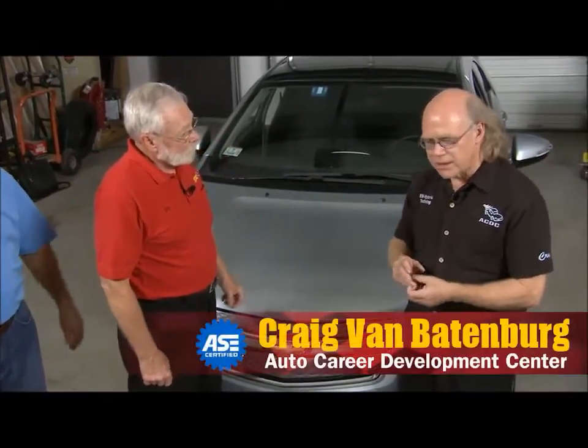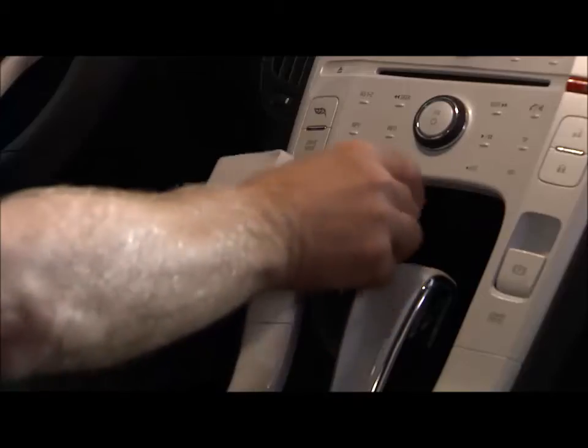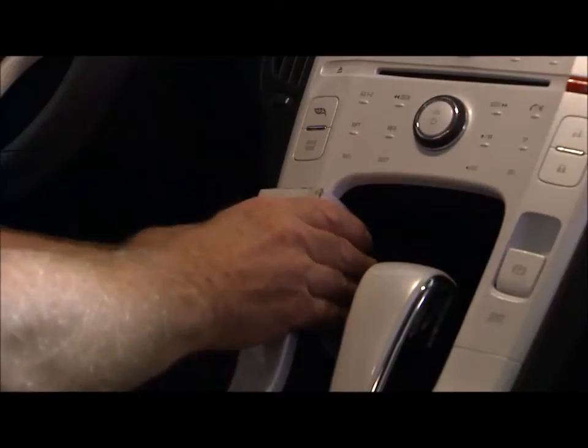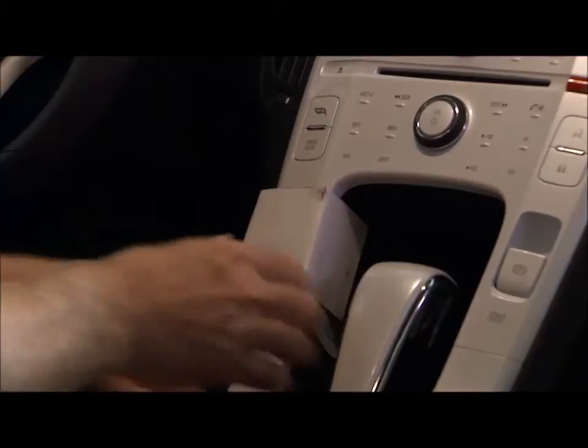Can I give you one tip before you shut it down? So when you're shutting this car down, before you pull that orange plug out, either disconnect the 12-volt battery, or if you don't want to disconnect the 12-volt battery, take some cardboard and put it around that little blue square power button used to start the car so you don't accidentally push the button in.